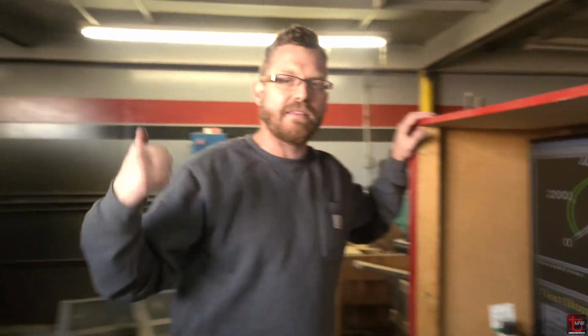Because on a setup like this, that's a high revving, small displacement, pretty big turbo, like I said earlier, all of his mods kind of favor high-end power. We should pretty much have just a straight line all the way out, and maybe even getting steeper and steeper as boost level is increasing. So there are certain trends that you have to know for certain kinds of motors, and that can help aid the tuning process.